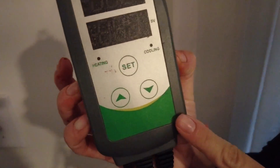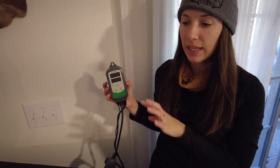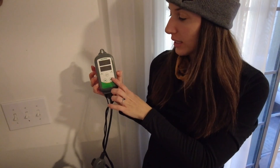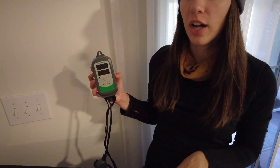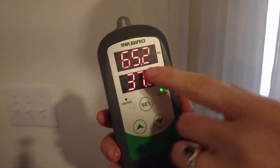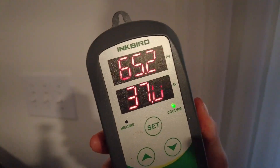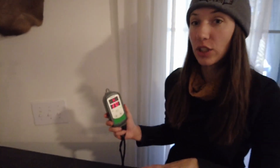That's how we cool it. To maintain the temperature of the freezer — we don't want it to freeze, we just want it at fridge temperature — we have this Inkbird controller. This controller plugs into the outlet and the freezer plugs into it. It has a thermometer that we feed into the freezer. We set our temperature on this and it will turn the freezer on and off to maintain a certain temperature. We usually set it to around 36–37 degrees. It's currently 65 degrees and the goal set temperature is 37 degrees, so you can see it's currently cooling with the freezer running.